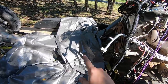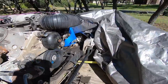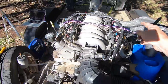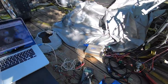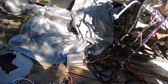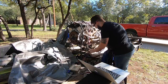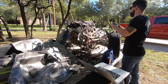The last time you guys saw me we were taking the torque tube off — I got that done, and now it's the next day. I've gone ahead and hooked up my fuel system. The little quick-disconnect to 6AN connectors came in, so we have a feed and a looped-back return line. Power and ground run directly over the engine. I also went ahead and hooked up the ECU and have my laptop as well. I think we are actually ready to turn the key on this thing and see what happens. I'm going to hook you guys up on a tripod and hopefully this thing makes some noise. I'm going to turn my key — fuel pump should be on, ECU is connected — let's see if it makes any noise.